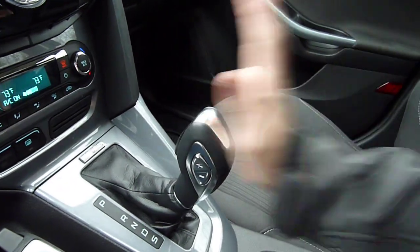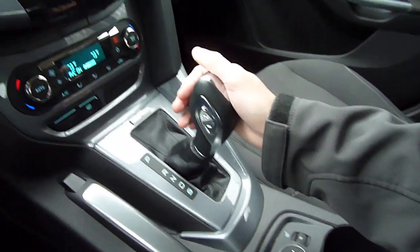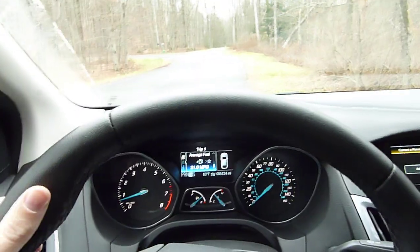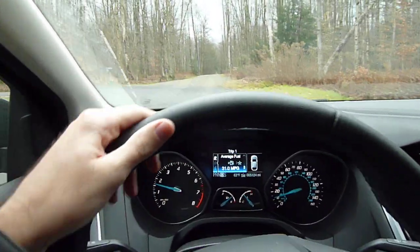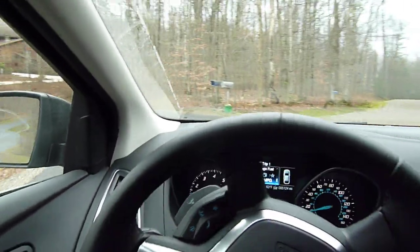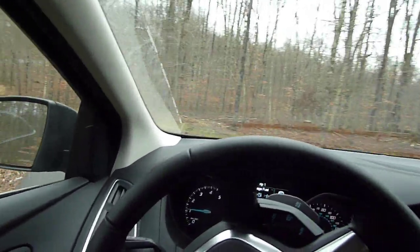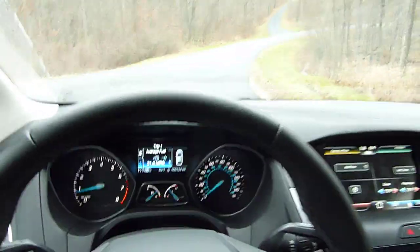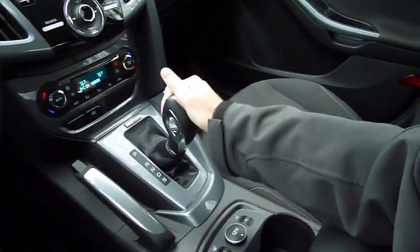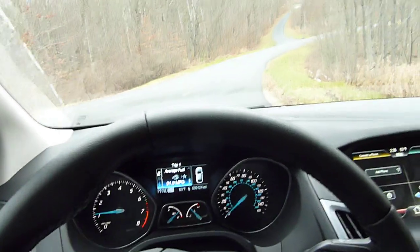This transmission is generally smooth, but launching in first gear is abrupt. It's okay on a flat surface, but on a hill it can be pretty rough. When you're in manual mode and going on and off the gas a lot, it behaves very poorly. There is a technical service bulletin now to fix the low-speed jerkiness, but hopefully it also fixes some of the throttle calibration.